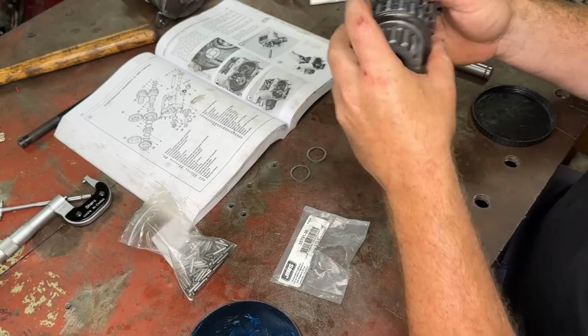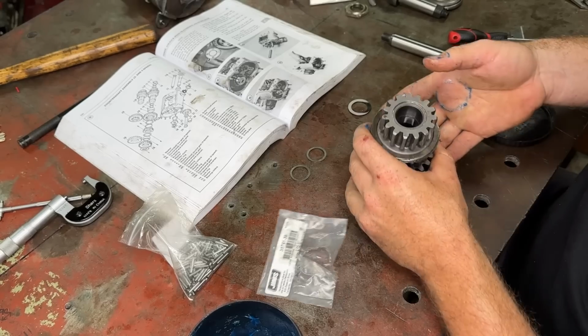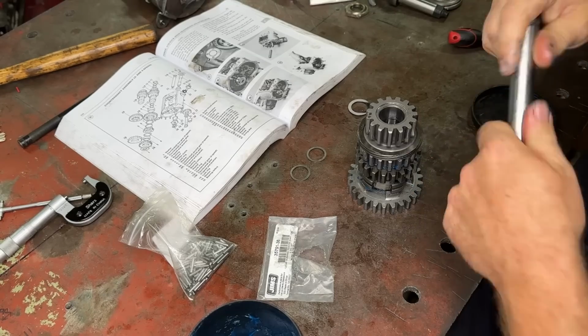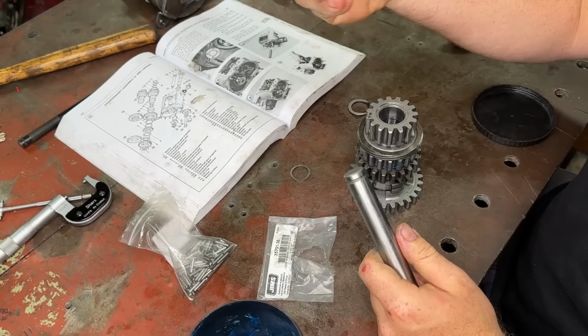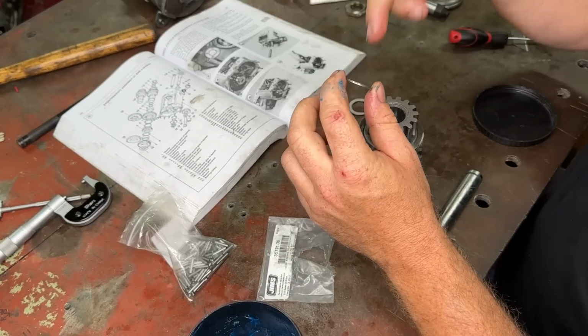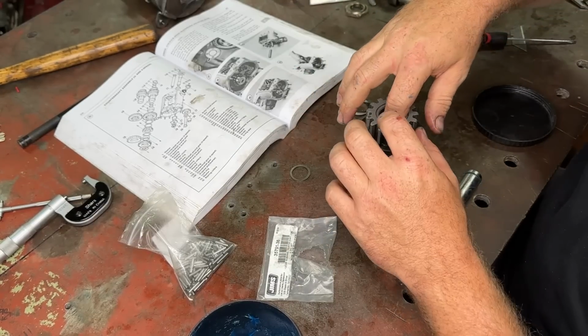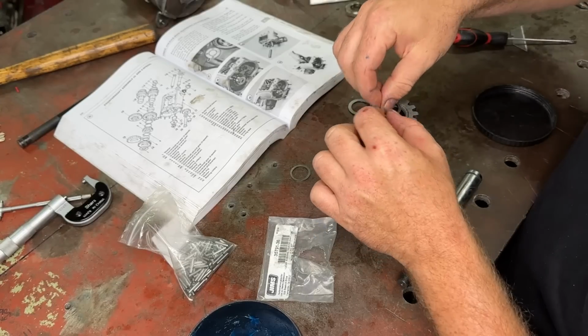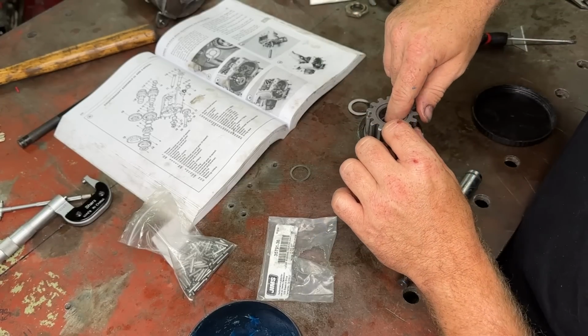Sweet, so that is that, pretty well done. The next thing we want to do is chuck our loose needle rollers in. Now, a little trick way to do this, put our washer in. So this is our bottom thrust washer. The needle roller always needs a washer top and bottom for the thrust. So he goes in there like that, whichever way looks the best.